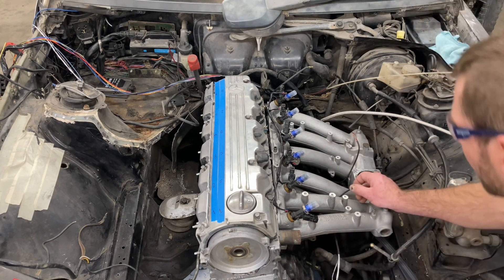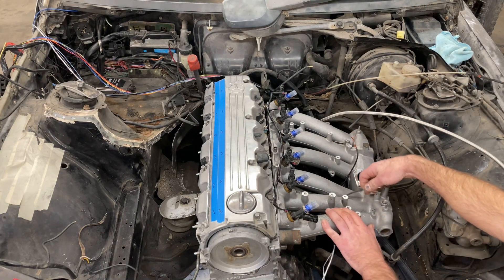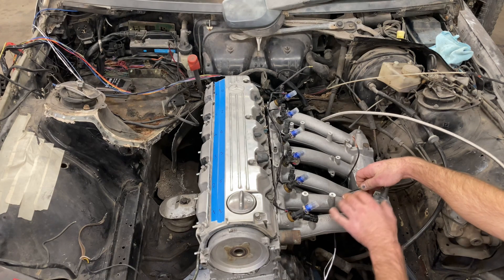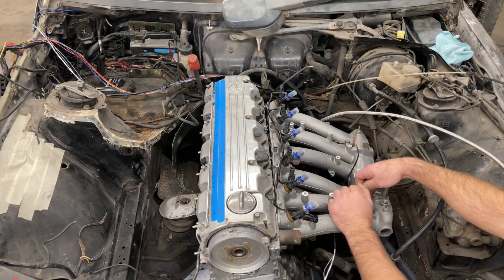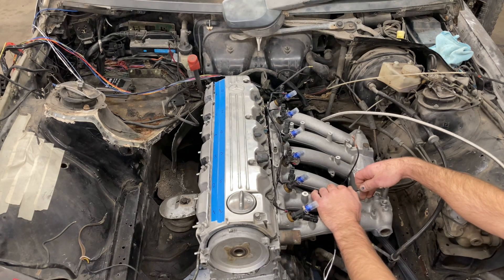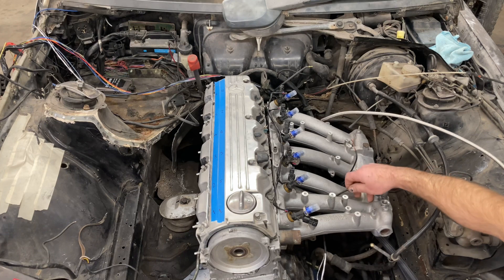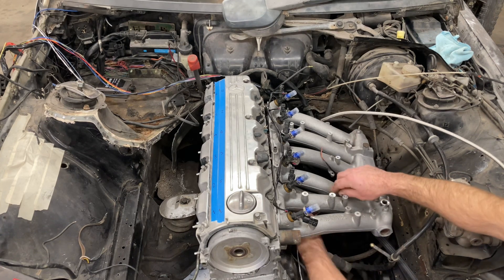This is the air intake temp. I'll either have it going into the throttle body right before it — that's probably what I'll do. I'll just have to weld a bung on one of the charge pipes. This will actually run underneath here too.